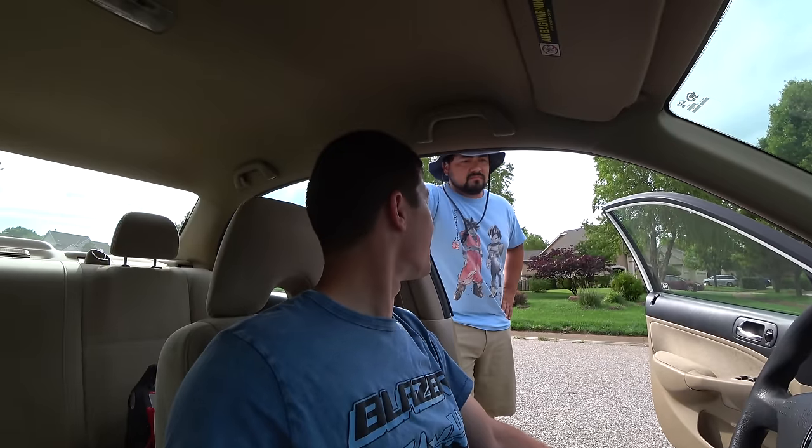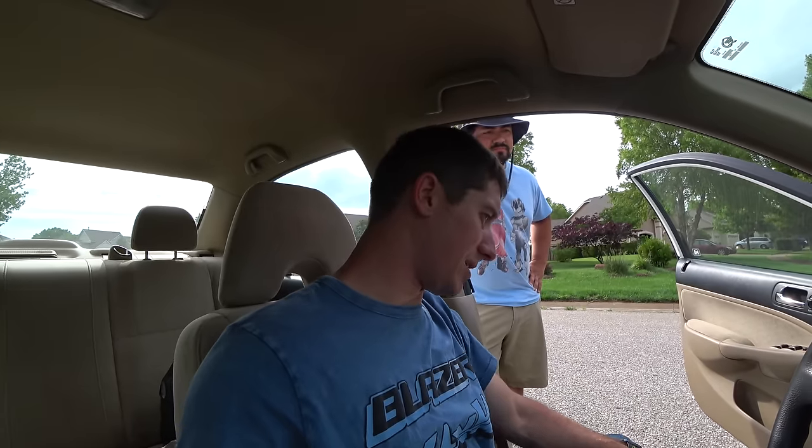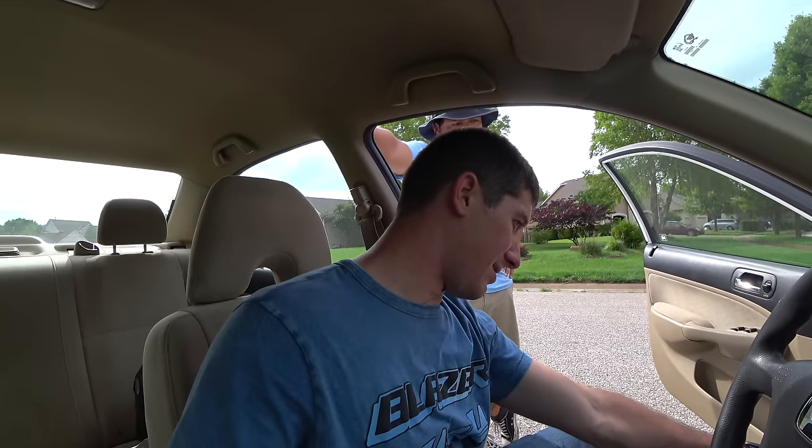Yeah, well, we've got an EPS light already, and I guess the 12-volt battery is probably toast, because Roberto was just telling me that as you drive it and the 12-volt battery voltage drops, it gets worse. ABS comes on, there's no power steering already. Yeah, it kind of turns into a nightmare, I guess. Cool that it has electric power steering when this is an 04. That is early. Yeah, everything's falling apart inside. It's angry.